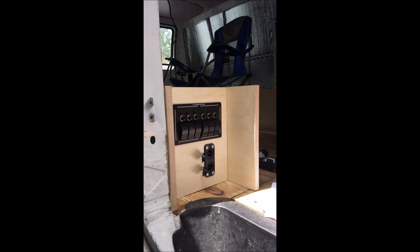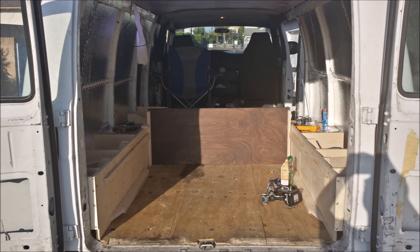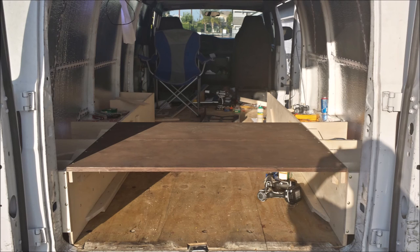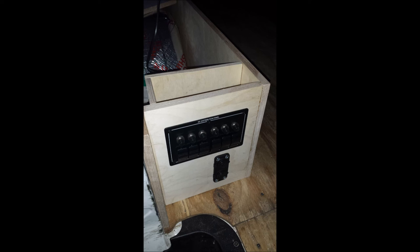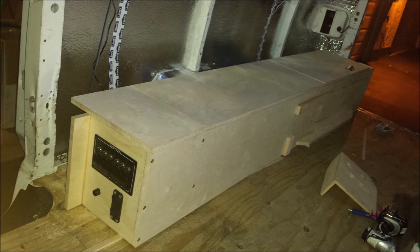I had two 12-volt lighter sockets on the front side. With both boxes pretty much built up, I laid everything out — the panel for the bed is right there and would block the pallets when loading work materials. I'd just lift it up and put it onto the front side. I started wiring everything up. The little gray box is a 24-volt to 12-volt step-down that can handle 240 watts at 20 amps. The other box on the back side is my solar controller — I got the SunSaver MPPT controller and a 300-watt panel on a 24-volt system.